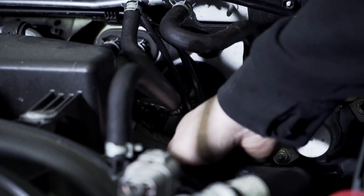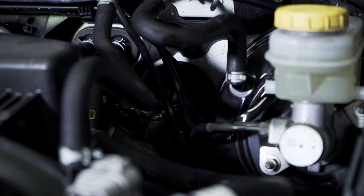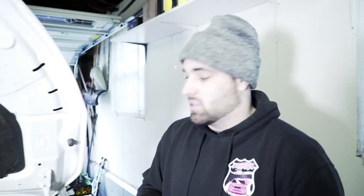To run the control wire for the switch into the cab, right down here next to the brake booster there's a pass-through for the rest of the engine harness. If you make a slight incision on the inside, you can send a coat hanger through, wrap up your wires, pull them through, and make your connection. Because they designed it so you can disconnect the switch from the rest of the harness, you only have to worry about fishing that small connector through rather than the entire switch — good thinking, Diode Dynamics.